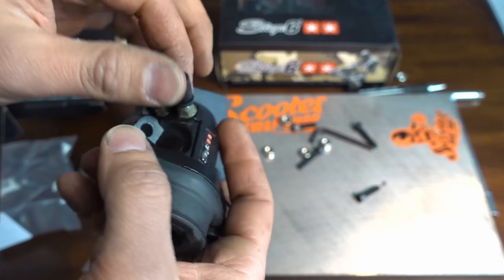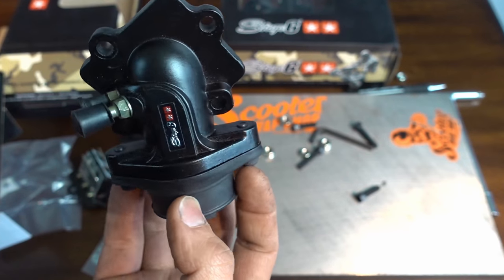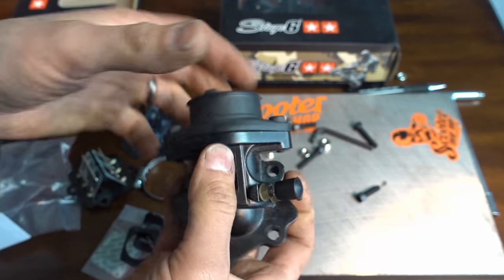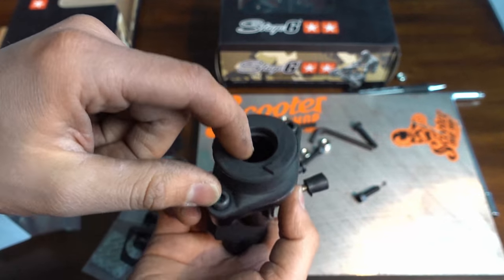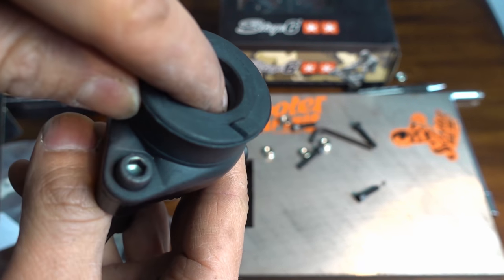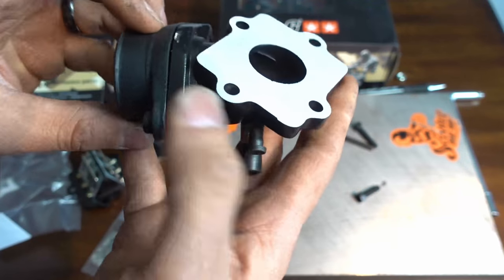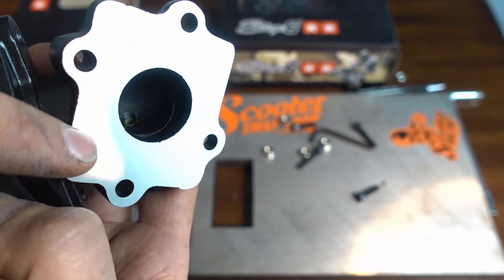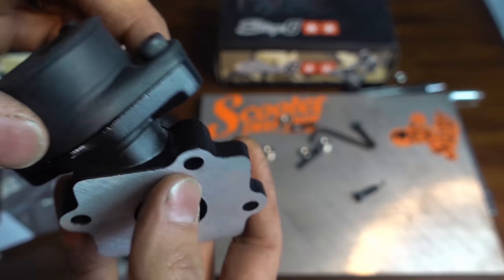If you end up pre-mixing and using a manual petcock, you don't need rubber boots. You're not relying on two hose clamps to hold the carb on. The CTs are really common for carbs just popping off and falling out. These Stage Six boots are really tight — the rib is going to click over inside the carburetor. If you have a carb falling out with this style boot, it's simply a bad installation or the boot is toast. The finish inside doesn't have the chrome. It's the actual casting — not that flaking chrome finish. You don't have that super Chinese chrome finish, which is nice.